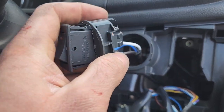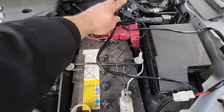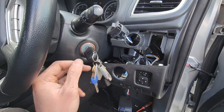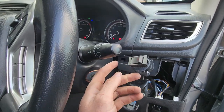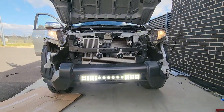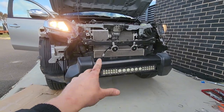I've connected the fuse. At the front I've connected the negative and positive from the light harness, bolted on, and put the fuse back in. I've also connected the light. Now we'll just test it to make sure it works. With the fuse in, get the keys, put the ignition on, start it, turn the lights on. Flick the high beams on — you can see the blue light — and flicking the switch down, she goes on. Check the front: they're on with high beam. Flick them off and make sure the high beams still stay on. Light bar is off with the switch off. Now we'll take the nudge bar off, put the bumper back on, make the cuts we need, then finish it up.